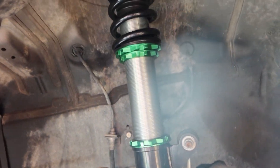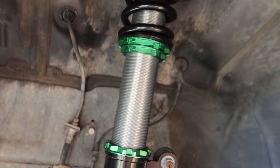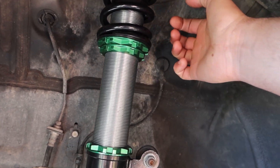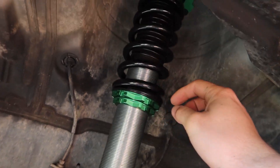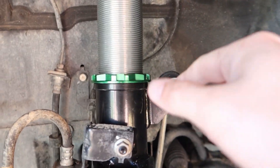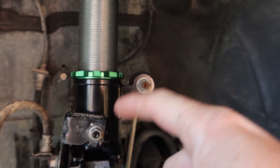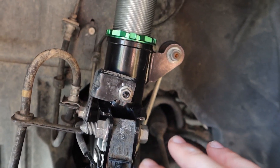Long story short, I went on a forum - a Facebook group called Lancer Nation - and got some help from them. Basically what I gotta do is twist this top one to the left and the whole thing comes down. As long as these two are together your spring rate will be okay. So we're gonna unlock this and then spin the top one to the left - do not touch the bottom one. What it does is it brings it down into the body instead of pushing up, so everything stays intact. You don't even have to loosen anything bolt-wise.